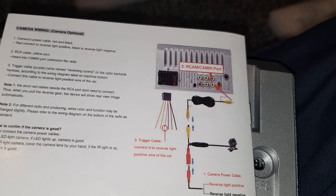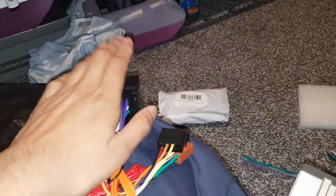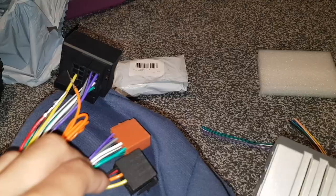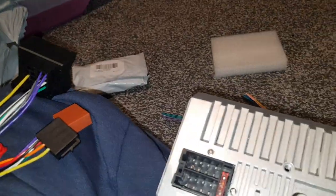It's still not a great diagram, but it's showing you how to set up the reverse camera. This wiring kit is definitely something you need — this end goes to your existing Polo connector, otherwise you'd have to connect each individual wire manually which is even worse. This kit has already done half the work for you. You just need to connect two wires and attach the reverse camera, which is simply connected there.